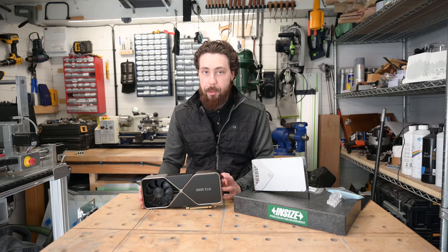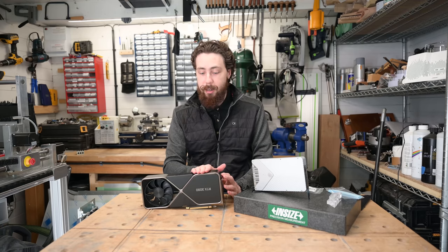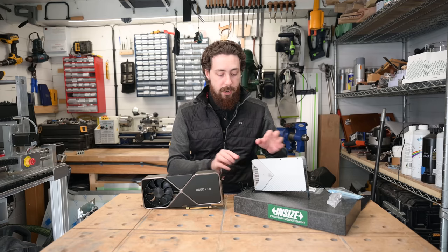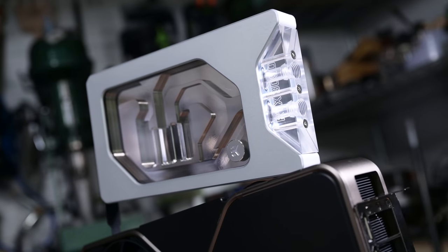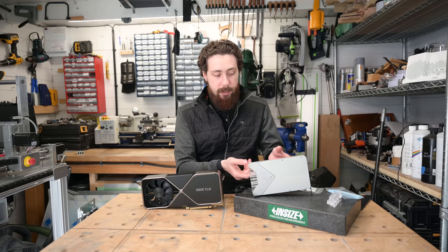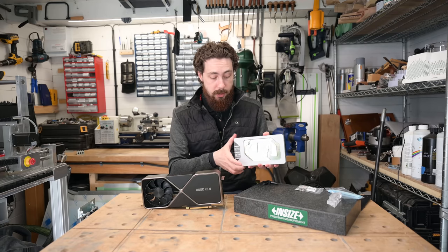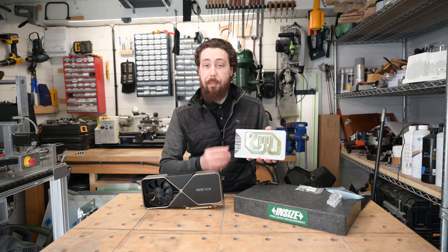And actually, a lot of mainstream chassis have problems with that. There were definitely issues with the Lian Li O11D, for instance, with the side glass getting very close to particularly tall cards. So actually having the ports over here is quite interesting. Now, personally, the reason I want to have the ports on the end is to be able to mod it. The issue with having them up here is that it causes the card to go up and down a lot, and actually it's quite difficult to integrate it into things like distro plates and side panels. Having them on the ends actually provides a fair bit more flexibility in that regard.